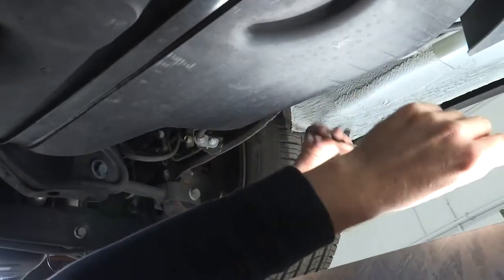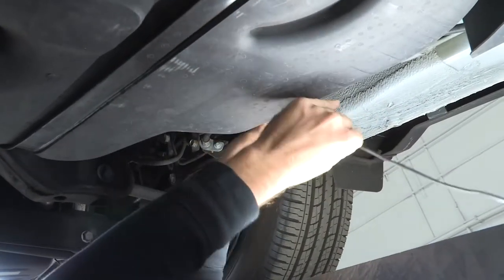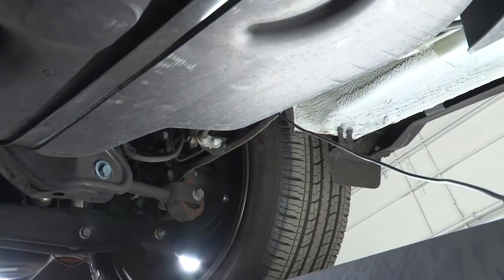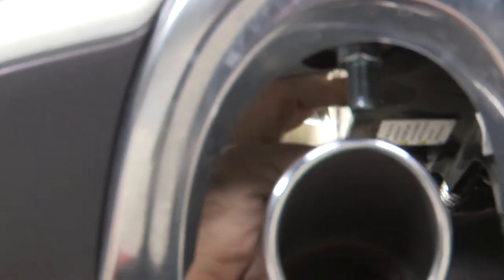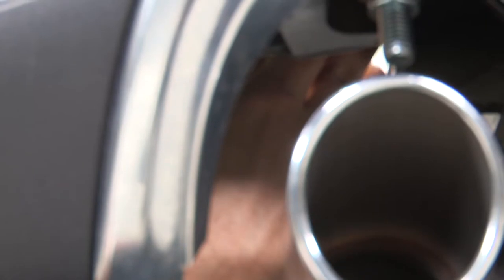As I pull this wire, I want to keep an eye on how much I've got remaining at the back of the vehicle. Once I feel it's pulled through, I'll double-check that we're good back at the rear portion of our harness. Now where I've got this power lead coming down from the rear fascia, I want to zip tie it to keep it away from the muffler and so that it's not pulled too tight against that sheet metal edge. I'm going to use a zip tie behind this bumper bracket to help route this wire safely.